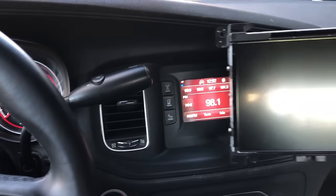I've done some research and found that there's an 8.4-inch screen available that fits in this dash. Calling the dealership, I wasn't able to get one, so I made some calls to a junkyard near me. They had an 8.4-inch screen out of a Chrysler 300 and sent it out to me — it was $600. I'm taking a chance here because a lot of information I read said it can't work, it's not going to plug in, and if it would hook up, you'd have to go to the dealership and pay exorbitant fees to get it programmed. I'm sticking my neck out. I'm going to yank out the little five-inch screen, drop in the 8.4, and see if it works.